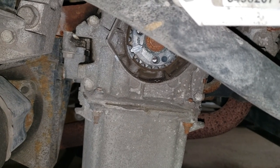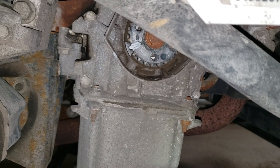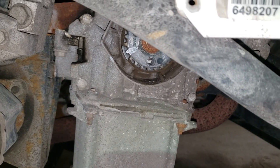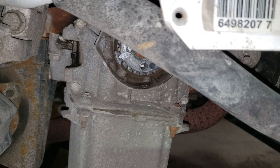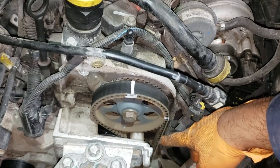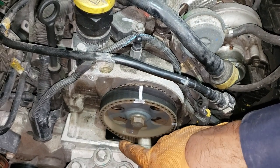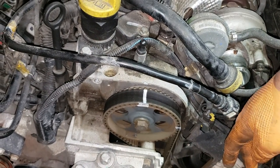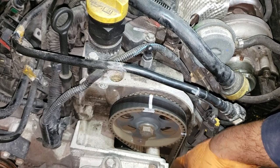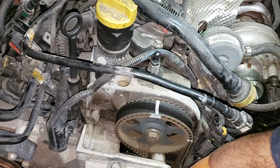On the crankshaft here you can see there are two markings on the cog belt, one marking on the crank pulley, and one on the oil pump — so there is no screwing it up. Remember to rotate the engine so that it is tight on this side and if there is any slack it should be on this side — that's where you want the slack adjustment to be. This side for the water pump should be tight.